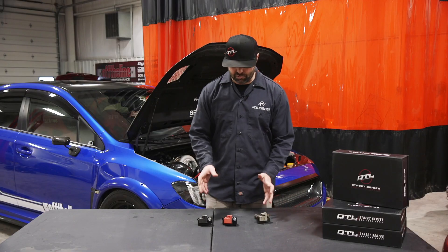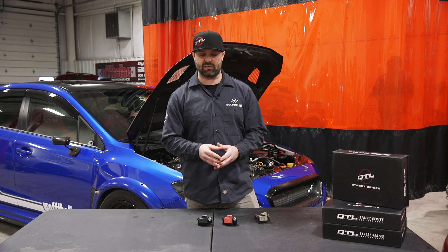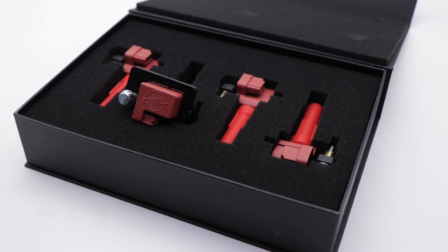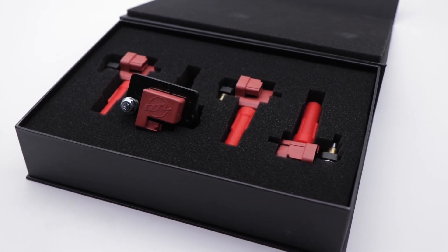The history on these coils and how we began was we started noticing issues with the ignition coils at above 550 horsepower, where you needed to gap the spark plugs down and we didn't like that because it caused drivability issues. You get random misfires and things of that nature, so we went down the path of designing our ignition coils to allow you to use an OEM size gap with the increased power output.